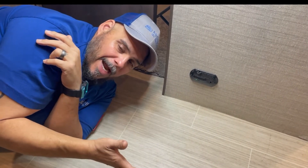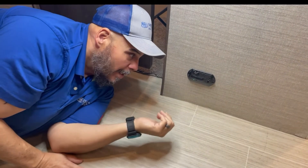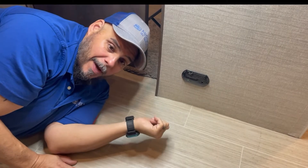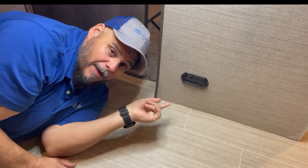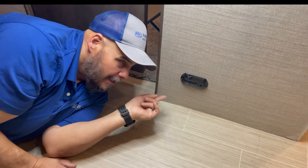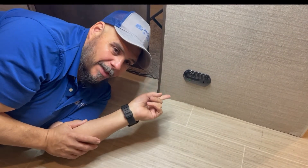In a case where the propane's not even on and this rig is empty — so there really is no propane running through here, even if it was open — we do have other reasons this could go off. One is low batteries. Say your coach or your travel trailer has a low battery; this will start indicating as a warning saying you have a low battery. You better address this situation, because we want to make sure you have the proper safety device functioning. This does run on 12 volts, so if your coach or trailer battery is too low, then this will start going off.